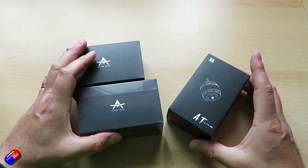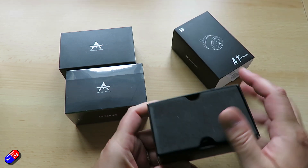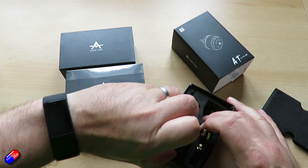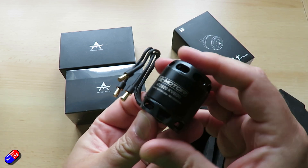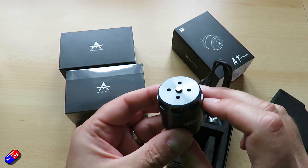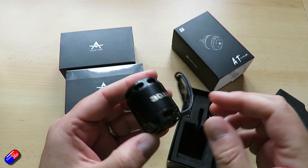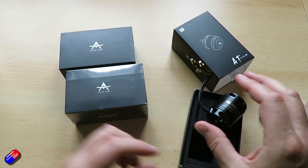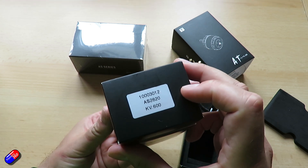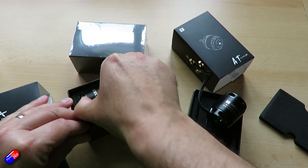So let's talk about the 1700 KV one first. The 1700 has really been designed for those larger models where you want a large KV to spin a small prop and get lots of speed. A 1700 would be great for the E-Wings Blackhawk and things like the E-Wings Vortigaunt that I made recently where you want something that has lots and lots of speed. I used a 1250 KV motor on those models and it's fine spinning a larger prop for the way that I like to fly. But I know lots of pilots like a 1400 KV setup on those kind of larger heavier models. But a 1700 KV — this one in particular — is going to be great if you want to fly it like you stole it.